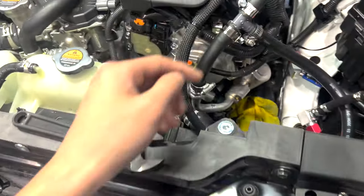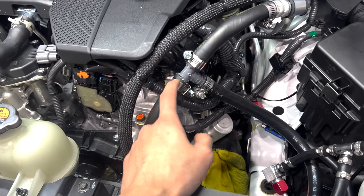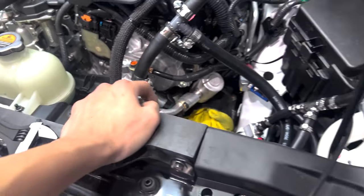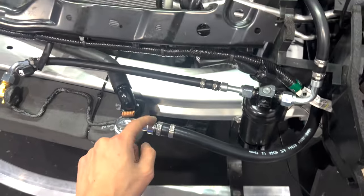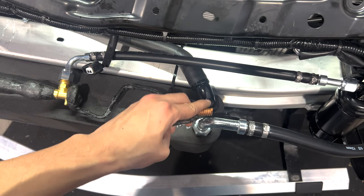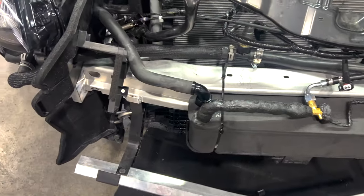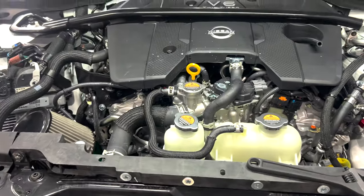Now, the suction line, we teed it off as well. This is not the best job, I don't think, at least not the best way we could have done this. But we just teed off that line to go all the way into this line, into the chiller. And this copper coil, we're going to attach it at the 11 o'clock or the 1 o'clock position with a clamp for that all to work. And the water lines are plumbed the way they've already been before. That's it.